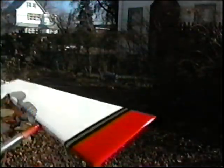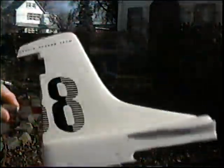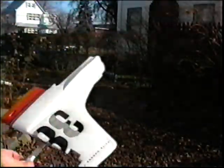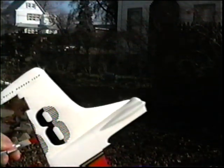What I did is I did a little test on some small parts that still need a little more clear because of the spots I touched up on them. I wanted to let this sit for a half hour. It's bright and sunny out here, but I don't know about the humidity. If this dries up without any sign of fogginess at all, we'll go ahead and paint the wing. And if not, we'll add 10% retarder, but we have to mix up some more clear anyway.